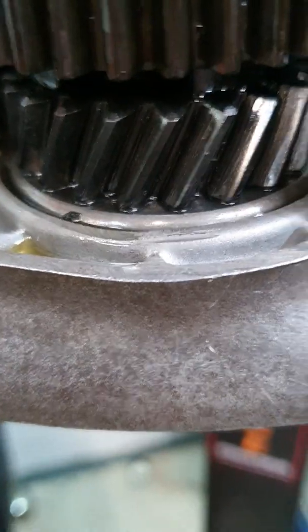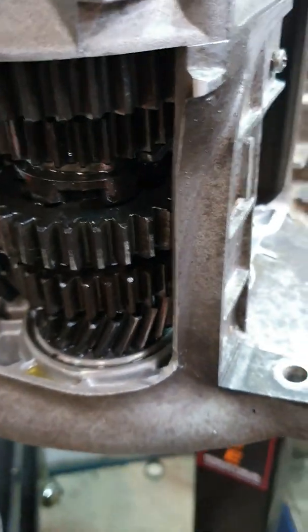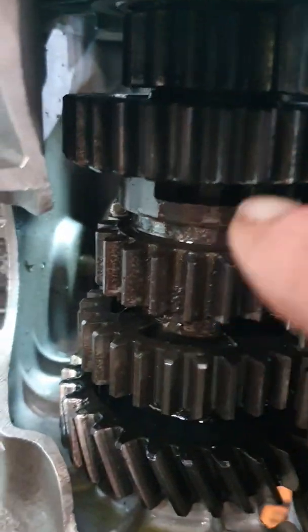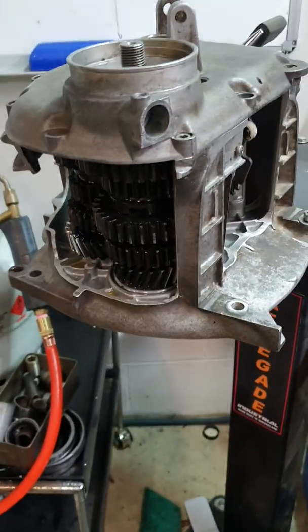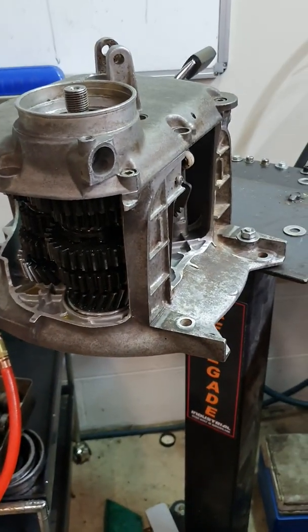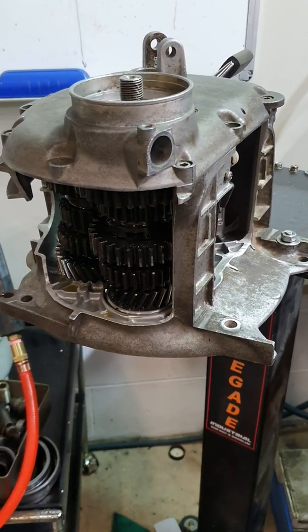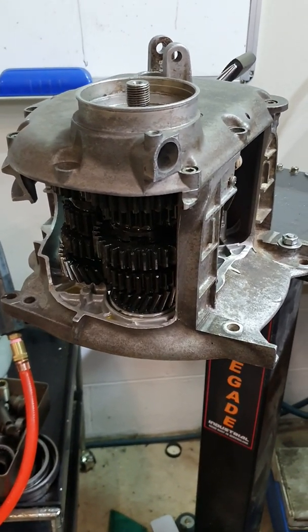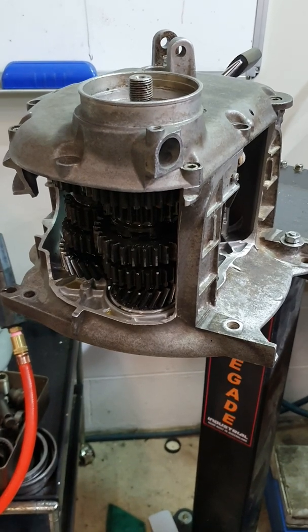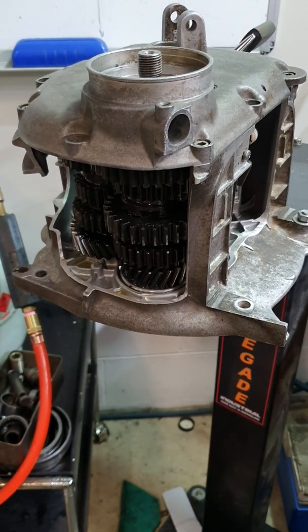That one down the bottom there is the helical fifth gear, which is the one that gets replaced with a taller fifth gear. The gear on the other side of the shaft is the one you replace if you're putting in a lower first gear. So 90 weight oil is what I use in my own bikes. It is a bit clunky on a cold day when you first start it, a bit sluggish, but once it warms up it seems to maintain a better noise output than multi-grade oil, even the 80W-90 Penrite.